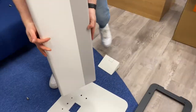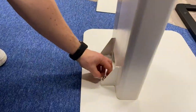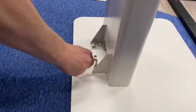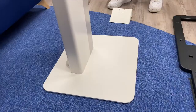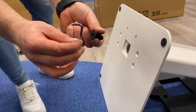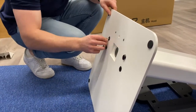Start by placing the stand on the base plate and line it up with the holes. Use the two largest screws with washers to secure the stand to the base plate, but do not screw them in too tightly until all the screws being used are in place. Then tilt the stand forward and use four black screws to fasten the plate to the stand from underneath. Hand tighten and then fasten all six screws with the allen wrench.